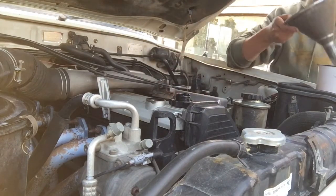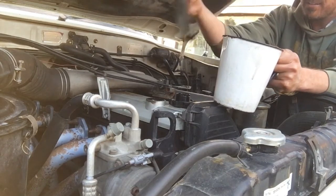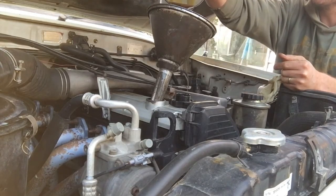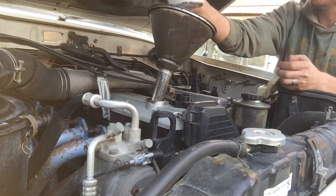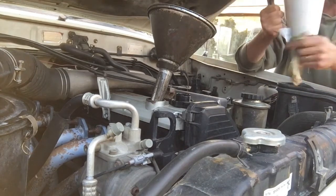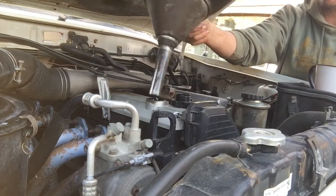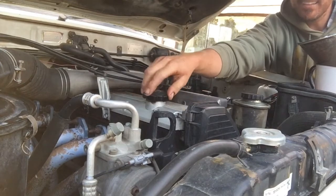After that we'll be doing the double checks. At this point, like at a 20,000 check, I would do things like check my drive belts are in good nick. I'm also going to check that the clutch and brake fluid's all good, and I'm going to do another quick tidy round, make sure the brakes are working properly. That's a good thing to do. So yeah.